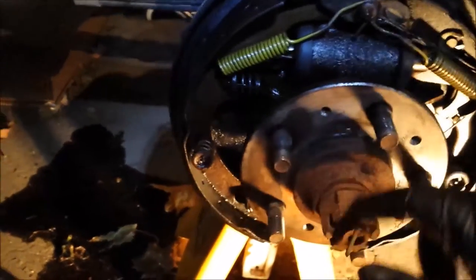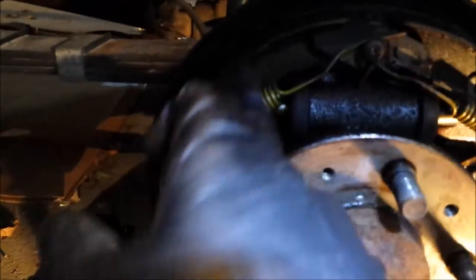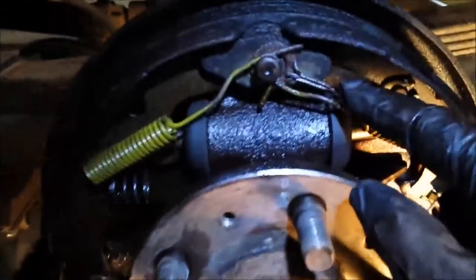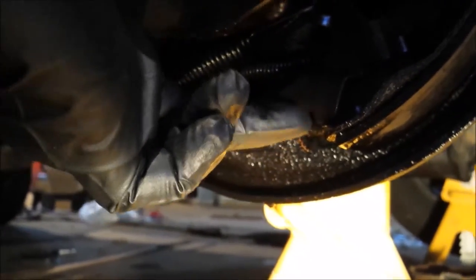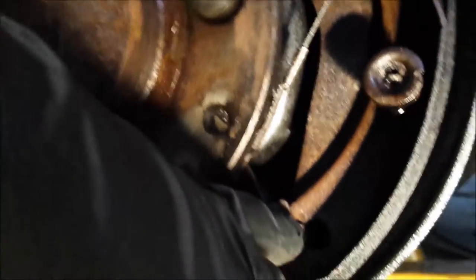Here's the wheel cylinder that you'll be replacing. Now here you've got two springs — these are going to be clamping the top down. You can just look at the holes and see that they're in these holes. Here you've got your cable going to your adjuster, and you can see the cable is actually coming apart — good thing we've got another one. That's going to go down to the arm. There's a spring coming from the shoe going up to this adjuster arm, and that's where it's going to be hitting the star adjuster, which automatically adjusts as you hit your brakes. That adjuster arm sits in this hole.